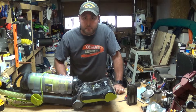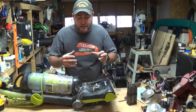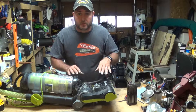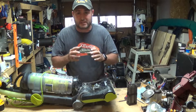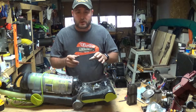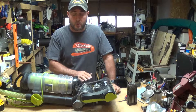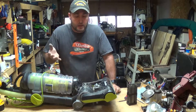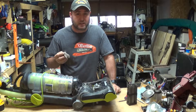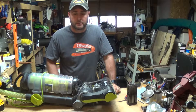Alright guys, hopefully that helped you out if you've got the same model. That could be the same thing on a different model too. What it's doing is it's getting the airflow blocked off from the motor, and the motor is what's both turning the brushes and causing the suction for the vacuum cleaner. As that airflow goes through there, it gives resistance to the motor — once it was plugged up with all that crud, the airflow wasn't going through there, so it wasn't slowing down the motor at all; the motor was going at full speed. It may have eventually burnt out the motor, or obviously it wasn't going to work for suction. So if everything seems to be working on your vacuum cleaner but it has no suction and seems really loud, that could be your problem — just a clogged fan or vacuum assembly. Hopefully that helped you out.